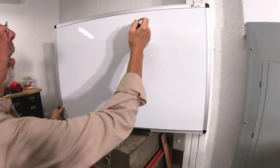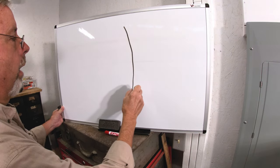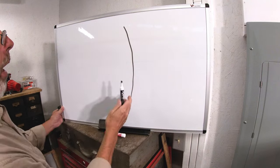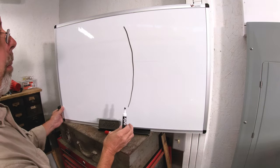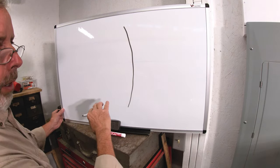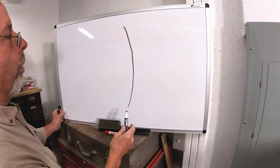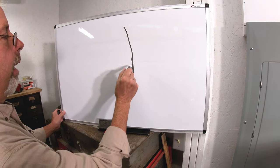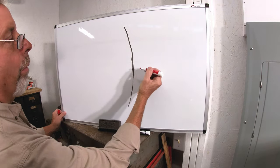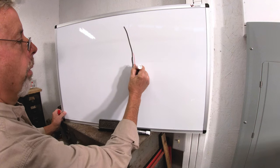If you're looking down the side of a vehicle, all vehicles are usually crowned out. Say this is the belt molding area and this is the bottom of the door — your handle's right in here, and it's always got a crown to it: fender, door, quarter panel. I think the idea behind that is whenever you have an arch like that, an arch is a strong structure — that's why you see bridges with an arc, they're hard to compress. That gives the body more strength. And if you've got a dent in there that you want to fix and you get in a hurry, and start banging on it without taking your time or checking your work in progress, you've got the possibility of overstretching it.